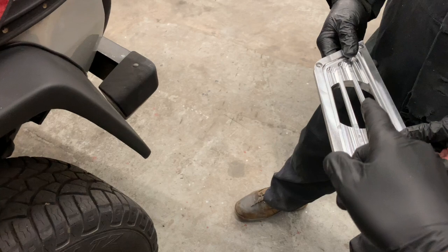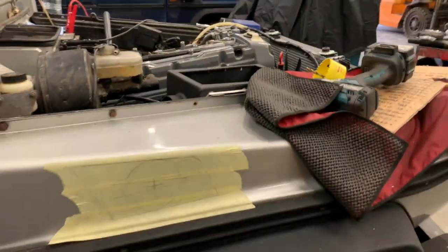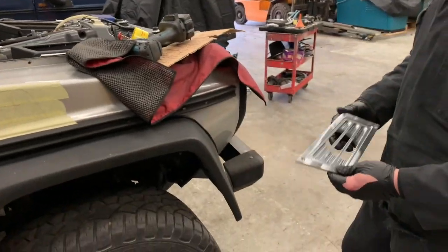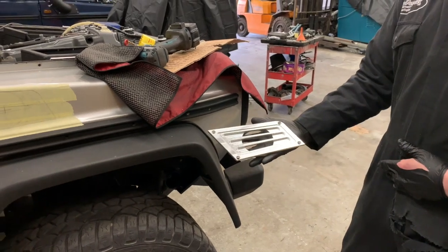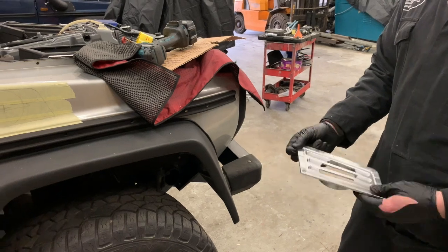And if water does happen to get in there, which inevitably it might if you're steam cleaning the car, we drill some small drain holes in the very bottom of the airbox, and that just allows the water to drain away. So there you go, from prototype to real thing. And soon we'll be showing you the finished product bolted on the car. Sweet.